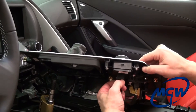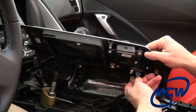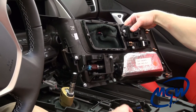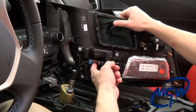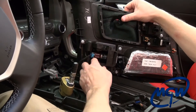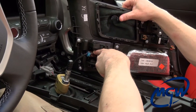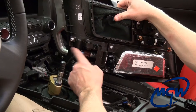We're going to take these connectors apart — you just squeeze the back tabs. You'll feel a tab in the back there; they're a little tricky. Once you get these two taken off you have enough play to move it a little bit farther over and you'll see that you have one last one here. This is for your power outlet plug, and you'll notice that on one side — sometimes it does vary — there's a little tab, and on this one it's up here on the top. So we're going to get a little allen wrench and stick it inside that little notch and then pull on this silver and blue piece and it'll pop right out.